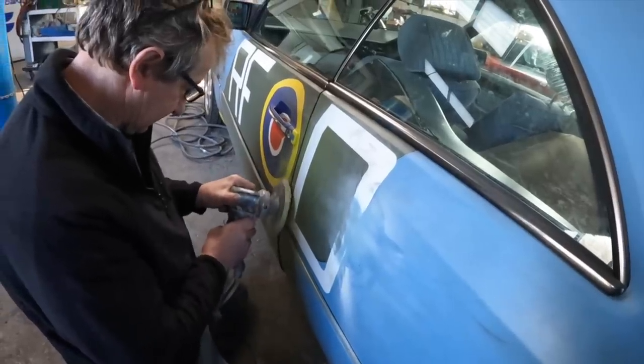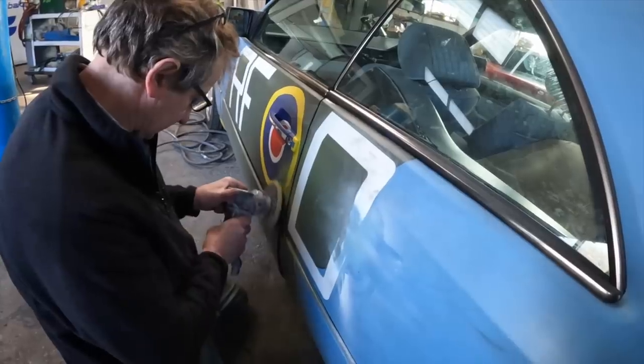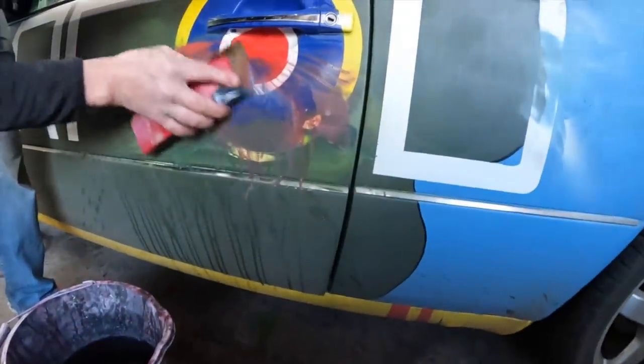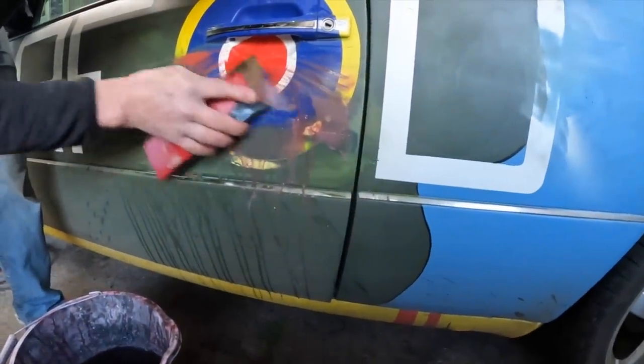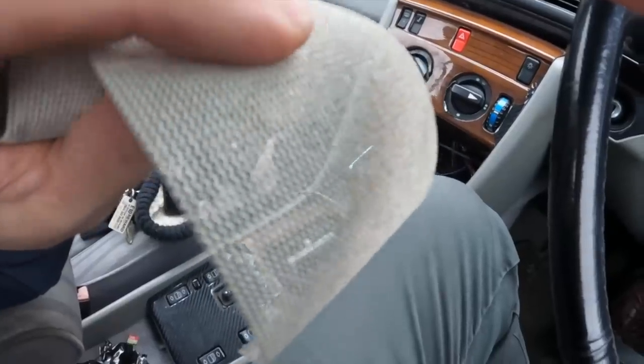The first thing that happened yesterday is I went to visit Andy and we did some testing on the best way to sand down the car. We tried various things like orbital polishing with normal sandpaper, then wet and dry, and also this net sandpaper I'd never seen before. That's going to be the best way to get rid of the painted-on designs because they're thicker and have ridges — the most important thing is to get rid of those ridges and make it all smooth.